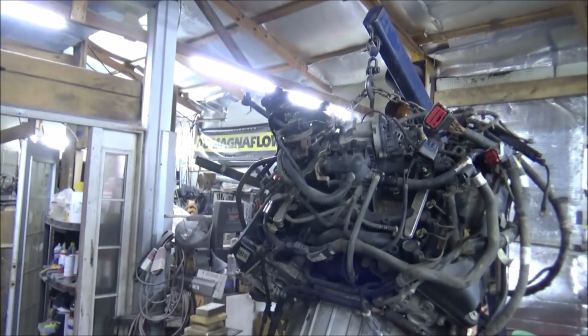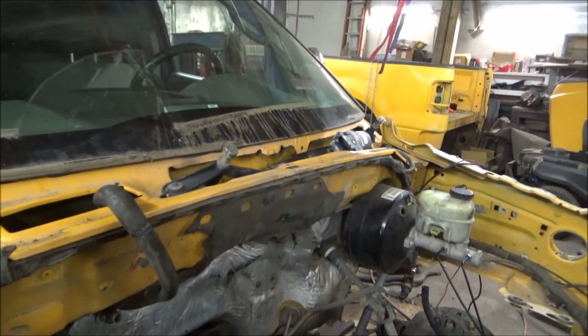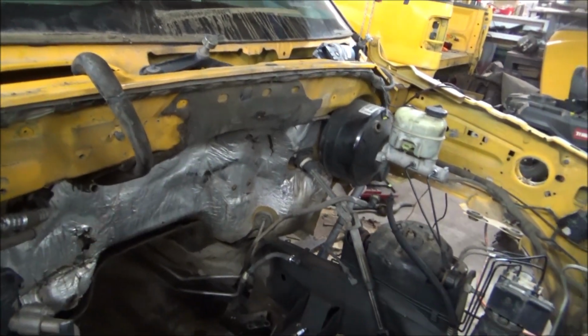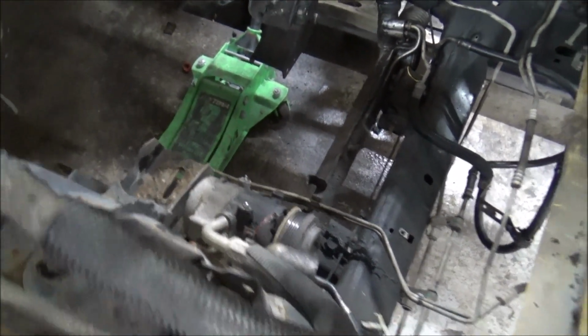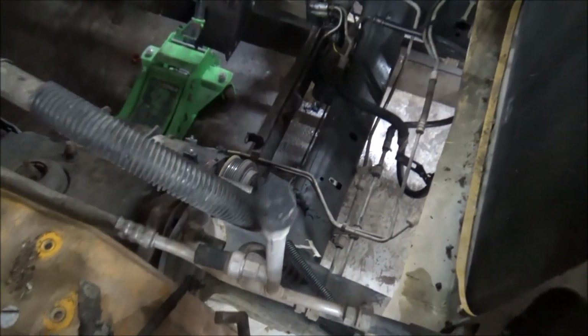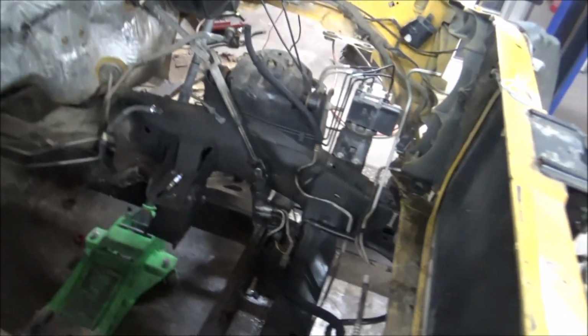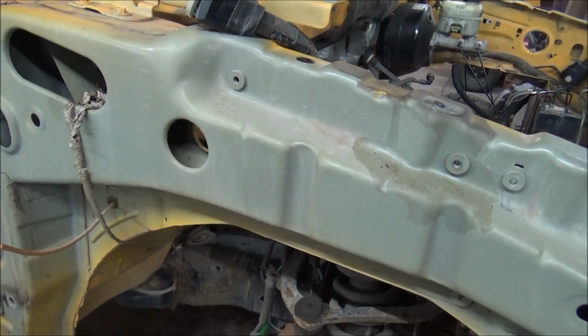We'll remember to take the EGR off of the red motor before we pull it, because that was hitting the firewall top there. But besides that, everything else worked out fine. Fuel lines stayed there, transmission lines. The AC compressor stayed in its spot, and it gets snagged. I didn't tear anything up, so I reckon that's a plus. But yeah, wow, far out. Well, at least we got it out of there. Now let's think of the next thing we're going to tackle on this bad boy.